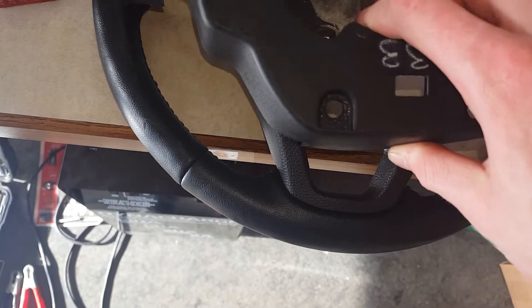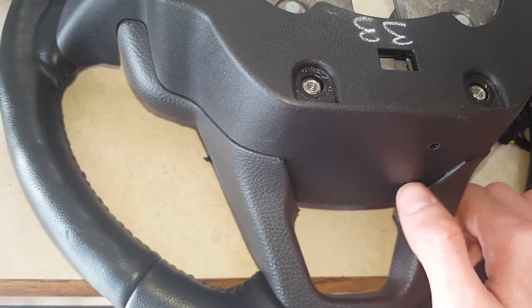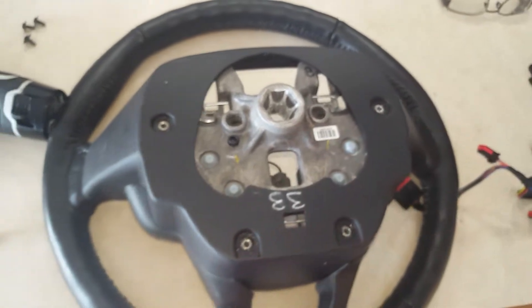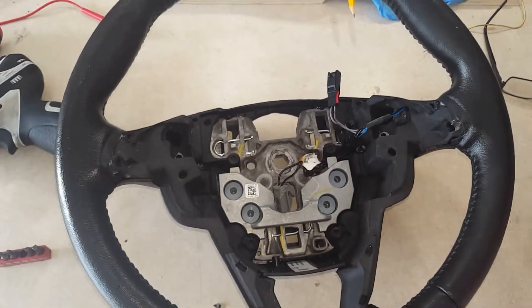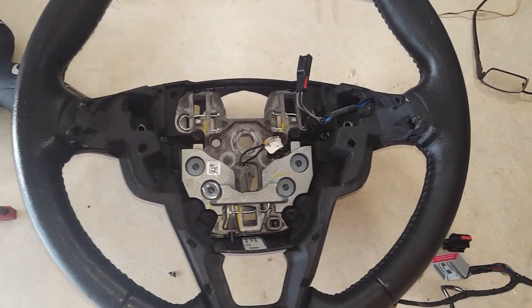Put in your cover. The way I find easiest is to have this one inside of the steering wheel first, up there. Make sure your plastic bezel piece is behind the steering wheel. Push down on it to make sure it's in, then go ahead and put in your four bolts and you're ready to go after you get that all connected — your paddle shifters and your wire harness.